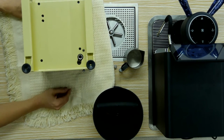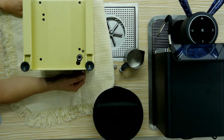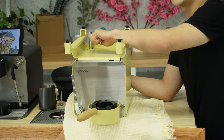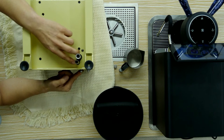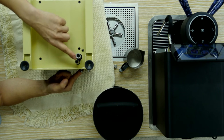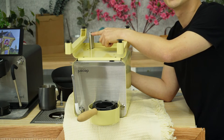The area we want to change — where the thimble, the stainless steel version, is located — is right here. It's a little bit hidden because the water level is now pulled down by gravity. There are two tubes: the tube on the right with the slanted edge is where the water sensor is, essentially detecting air pressure. The longer tube to the left is where the thimble is. From the side, you can see small rectangles just underneath the thimble — if you're up close, you can see the mesh behind the pipe.